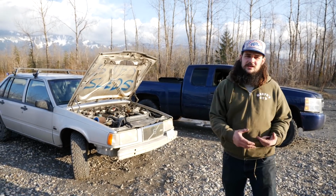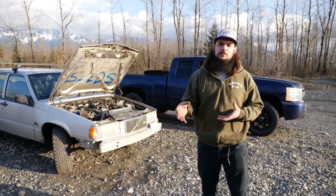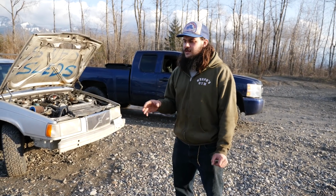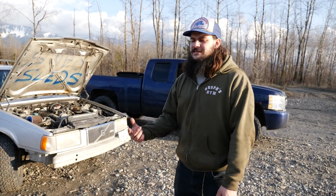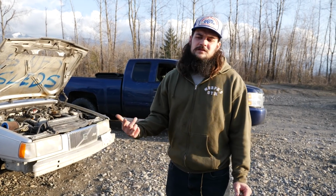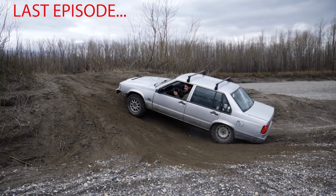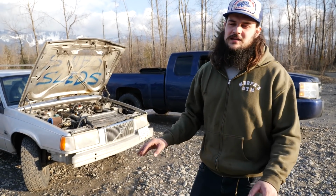So if you watched the last video, you'll know we got all the off-road stuff on it and we went and tested it out. It was pretty good, although we did damage a few things, and I actually improved a couple things this time around. Last time out we had the G80 locker, so that wasn't the greatest because it kept kind of opening up on us. One tire was spinning and then the other one wasn't. So we were actually getting stuck in random places that we shouldn't have got stuck in.